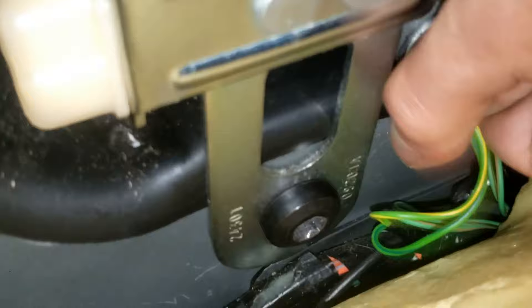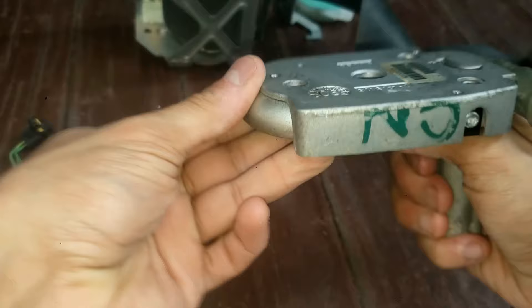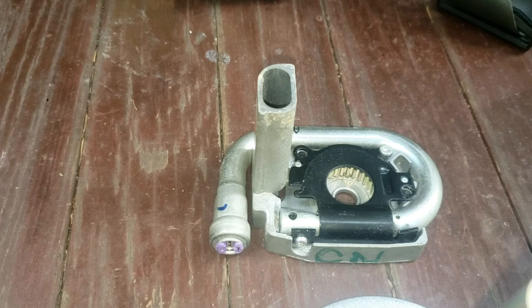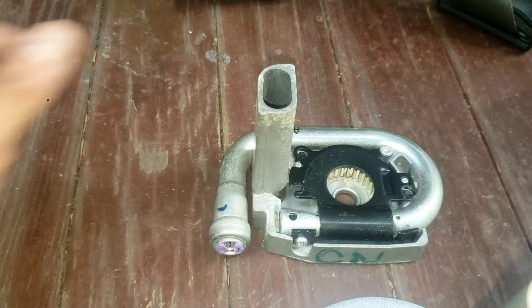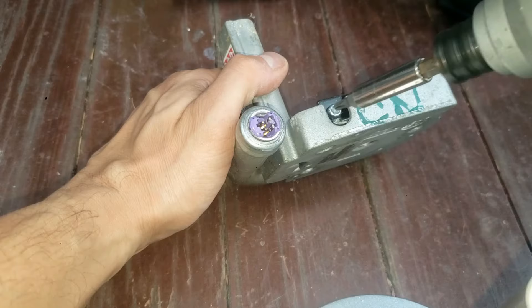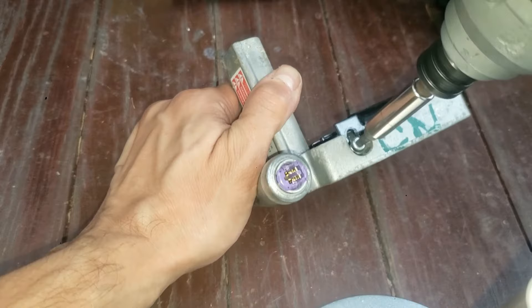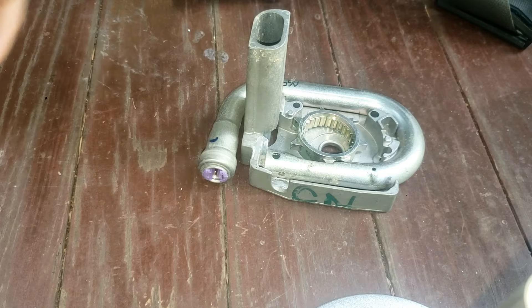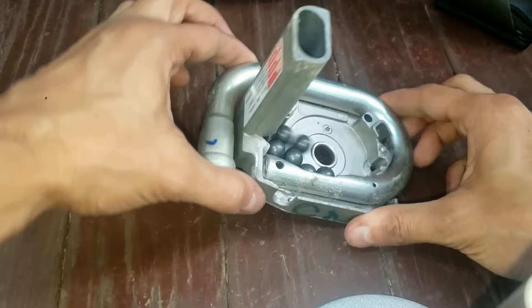Now to work on this metal piece. As a warning, do not take this apart if you are planning on reusing your belt buckle — once opened, the balls inside will come out and it will be very difficult to get them back in perfectly. This piece connects to the airbag through the wire harness, and when the airbag is deployed, so too does this piece. This chamber explodes and pushes all the steel balls out, hitting this sprocket or gear, making this unit unusable.